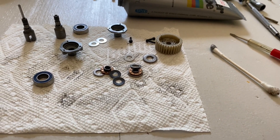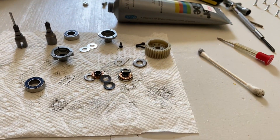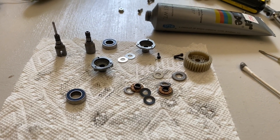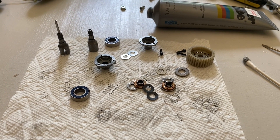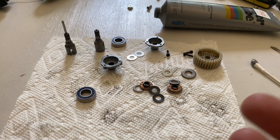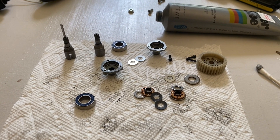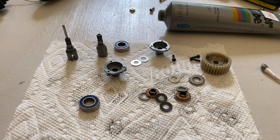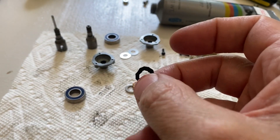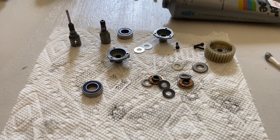What we're doing right now is putting back the differential. It's open for a reason — I test drove the truck and it doesn't run well; there's too much slipping. That happens a lot with these trucks when they have this type of transmission — kind of the Achilles heel. There are companies that make all kinds of aftermarket support for this fix; Thorpe's one of them. You can even change out the gearboxes from other car companies. But I tend to just go with a piece of rubber material — almost like a rubber bladder — and replace one of the plates. It's just my way; I don't suggest anybody doing that, but for me it works and it gets the truck running.